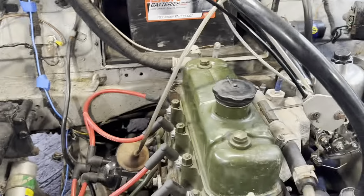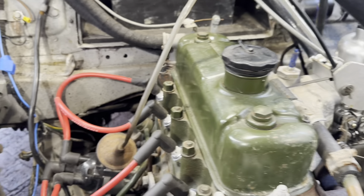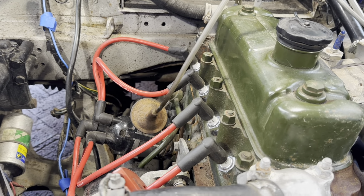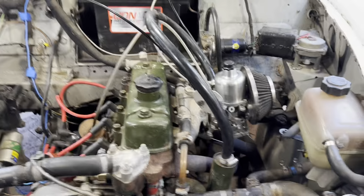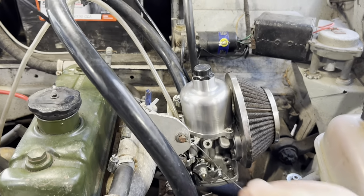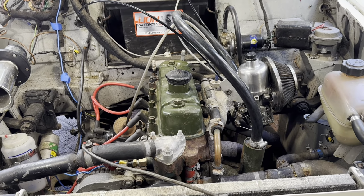Okay, so we've got the engine all running, new carburetor on, everything's timed in properly. The distributor hasn't really got the best advance curve in it, but for today, because the customer's already bought the carburetor, we don't want to give him a double sting. The vacuum unit is working, but it's got a little bit of a leak on it, a very slow one, but the customer knows he's going to have to replace that unit later anyway. In terms of needling, the BDL was a touch rich, so I actually went for a BF wire, and it's spot on. We'll send the owner out on it, see what he thinks.